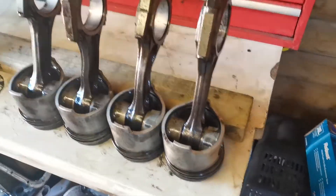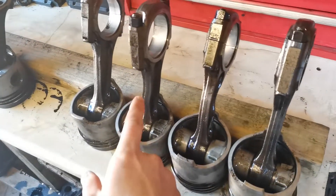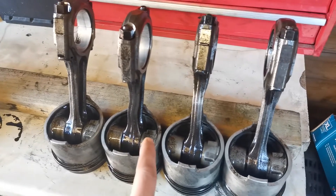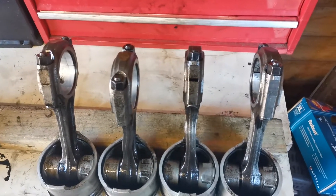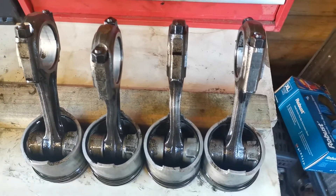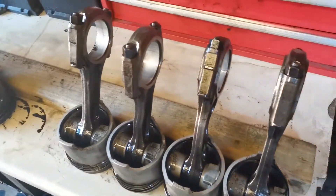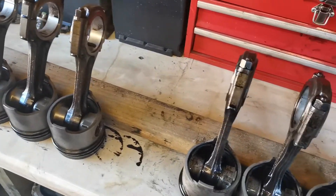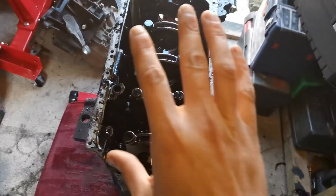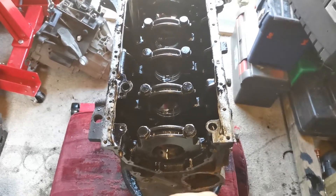Yes, you'll see that I've got the bent conrods, as was suspected in part one. I suspected broken conrods, and I'd also had a heads-up from the guys on the Citroën forum that they do tend to bend conrods. But I'm not overly worried, because when I put this engine together it's going to have all new bottom end shims, all new bottom bearings, all new seals, all new gaskets, all new everything — rebuilt to the same spec as it left the factory.